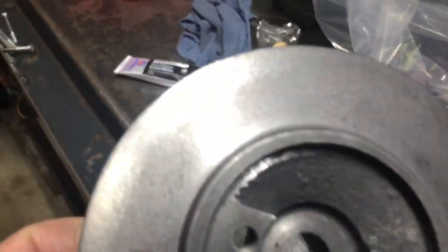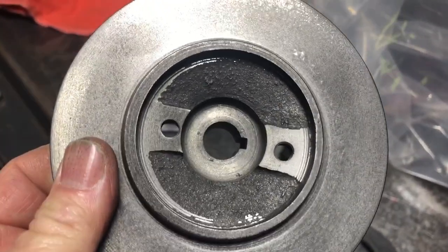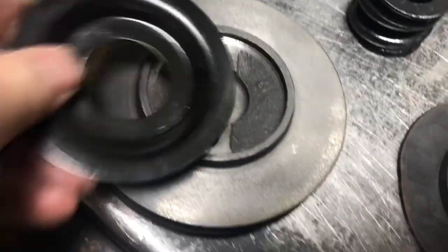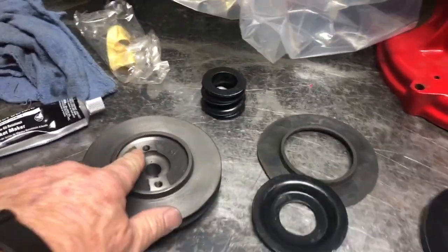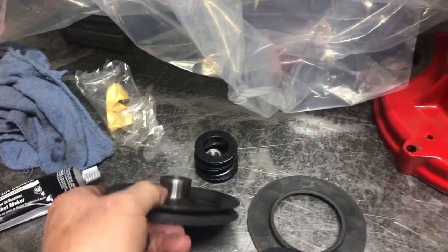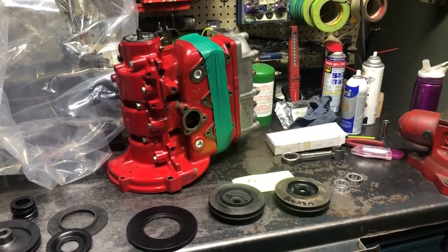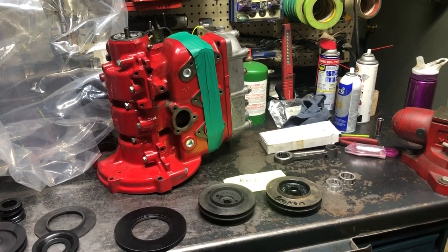If you've got some issues or think you might have a new pulley on the front of your motor — and again it's only Mixer motors, not Monte Carlo — check it. If you don't have any marks on there, see if your plate's been hitting, because that's going to cause your problems. You're going to need to cut about 80 thousandths or so off of here, and make sure your seal area has been cleaned up so that your seal will live. And don't paint that area, please. Alright, that's about all I've got for today — this is Tom Donnie from Fort Dodge and Sturgis, signing off.